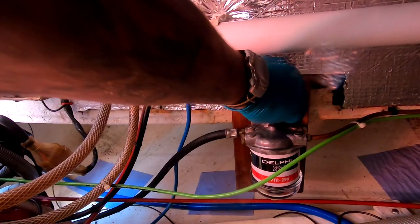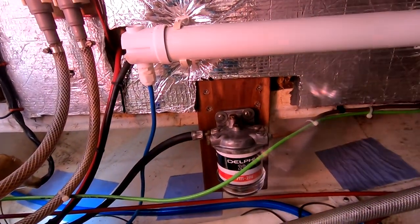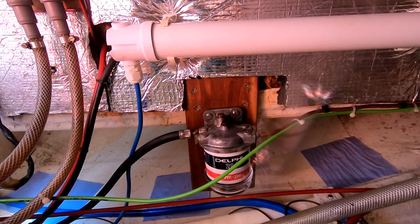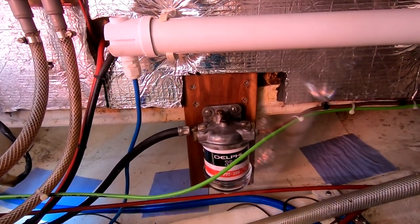What I'm going to do now is close the air vent to save any accidents, go and open the fuel cock, and then come back down here and open the vent again — allowing the bowl to fill. I'll get the engine started, make sure it doesn't leak, make sure all the air is out. If it needs bleeding I'll do so, then I'll leave it for 24 hours and monitor it with a pot underneath it.